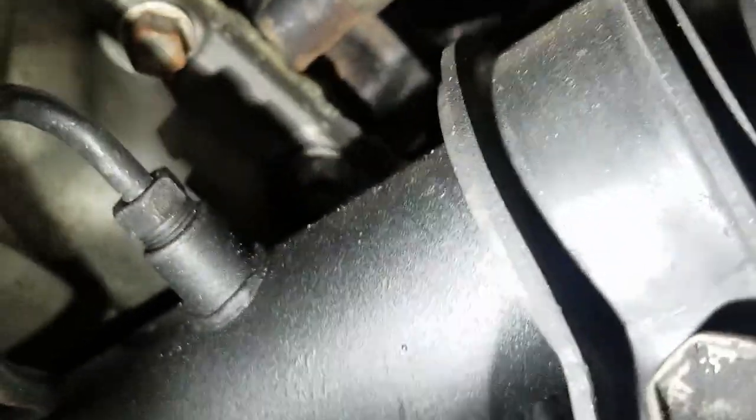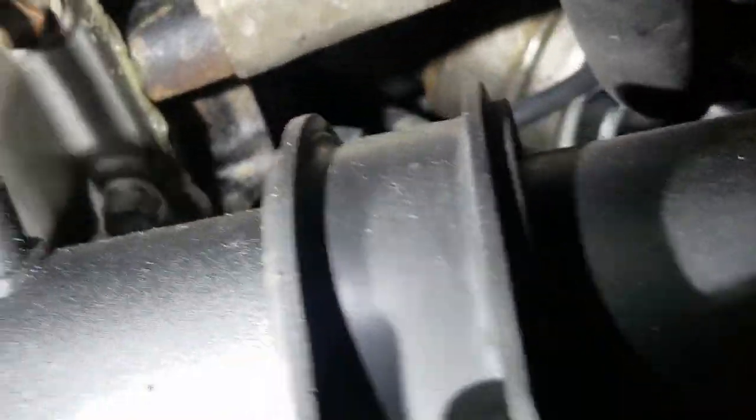Another oil leak, it looks like. I'm thinking it's the lower oil pan because it doesn't look like there's any oil above it, which is pretty much, I mean, that's a dream oil leak right there. Oh no, it's the oil drain. They do those a lot. Yeah, so they probably just didn't seal the drain properly. So no, that's the old drain leaking.